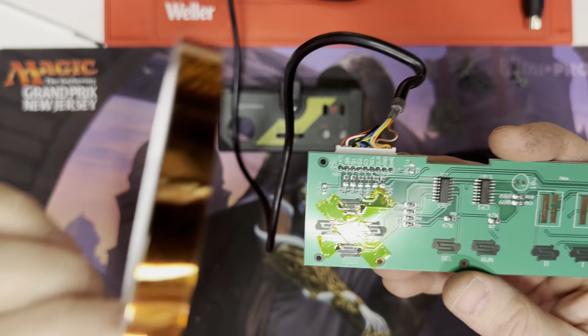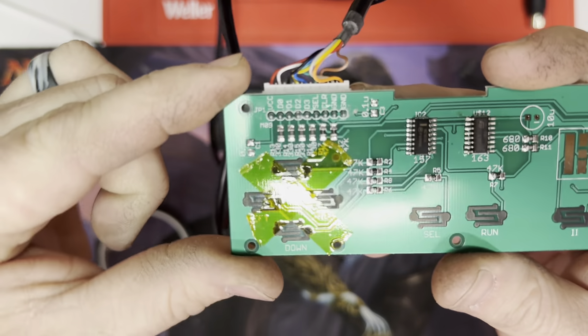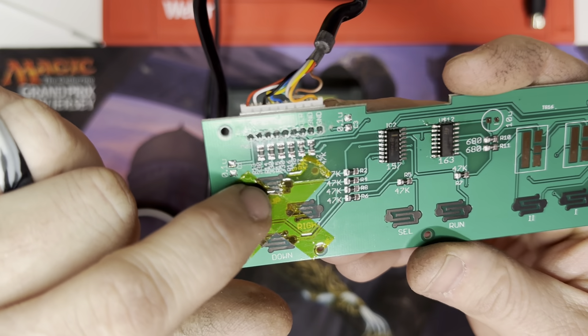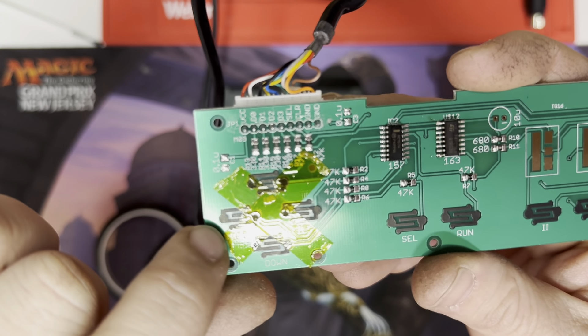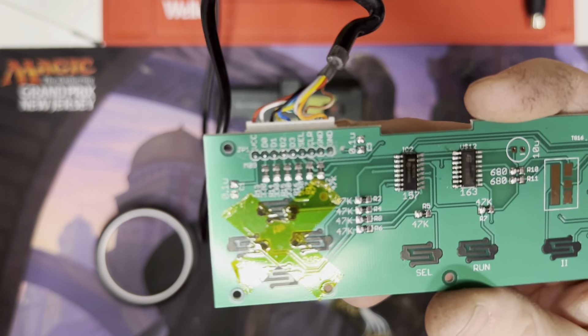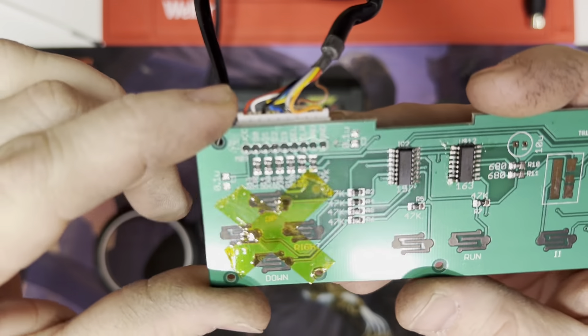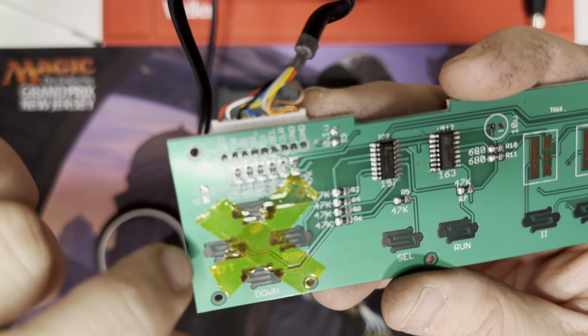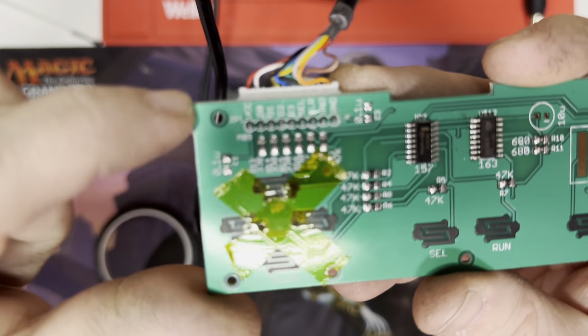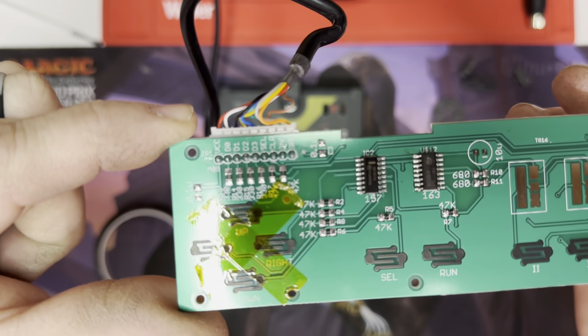So using a little bit of thermal tape, I created a cross. As you can see, there's an X across the pads. And I just shrink the area of contact to make it so there's not so much misinterpretation when you're pushing the directions. When you're putting it across, just make sure that you do leave room for a good contact, and you won't have all the missed button presses.